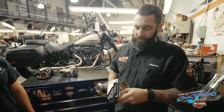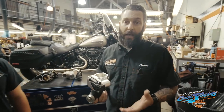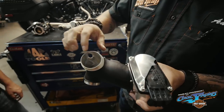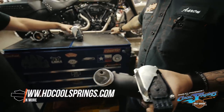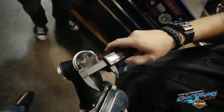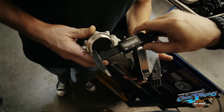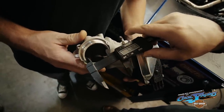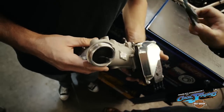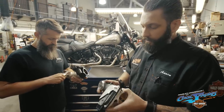Branch and O'Keefe disagree. They say they know it flows better when ported. What it's going to do for horsepower and torque when attached to a bike running in a dynamic condition, we don't know. So we're going to test that and we'll have those results for you here shortly. Another cool thing about this intake is we can custom order the intake inlet size. This one measures one inch 90 — and it measures one inch 89 on this one, really close.